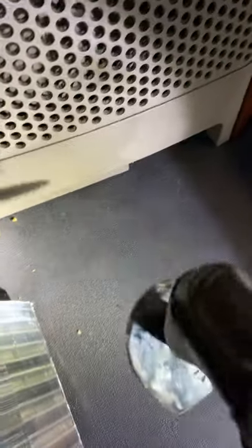I got in here, cut one side, cut the other side, and made two small cuts on each end. Then I popped it out using a standard screwdriver — just stuck it in there and popped it out. After you detach the hoses on the bottom, this heater core literally just pulls right out of there.